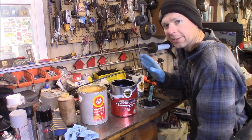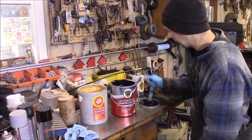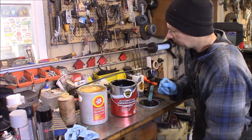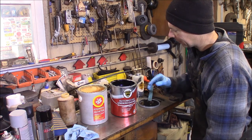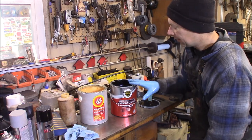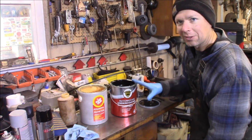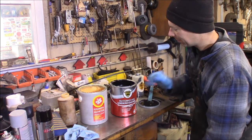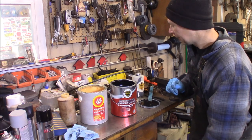This is definitely a thicker product — as I was trying to spray it in cold weather I had to stop because it got too thick; you'd need to heat the material with a heat gun to keep it flowing. Fluid Film sprays in a little colder weather since it's thinner. I'm excited to see if the Wool Wax sticks on and lasts longer during winter because of its thickness. I love having wheel wells, frame rails, and springs blacked out underneath the truck. I want to use this Wool Wax black on my '77 Ford truck in the springtime on the chassis and suspension — protect it and have the chassis be black. They're both excellent products.